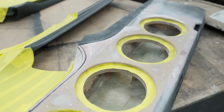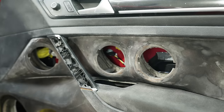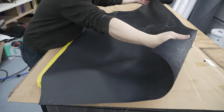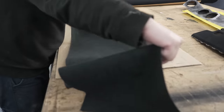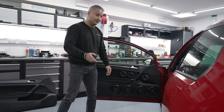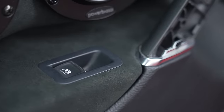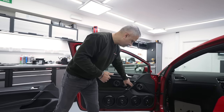It's a constant going backwards and forwards between the woodwork room and the car because you need to ensure that they fit correctly — they fit on the door card and also when you close the door that they don't touch the seat. The last thing you want is a door pod which hangs into the cabin area and when you sit in the car it's rubbing against your knee. On the lower section of the door card we've covered it in vinyl to match the original finish. Where you've got the three horn tweeters, we've put some Alcantara. We've had to raise the section here just to give it a bit more strength. We also had to move the switch — on the passenger door card the switch sits just behind the door handle, and if we'd kept it in the same place you wouldn't be able to reach it because of the horn tweeter. We relocated the switch and done that on the driver side as well, where you've got two window switches — one for the driver side, one for the passenger side.